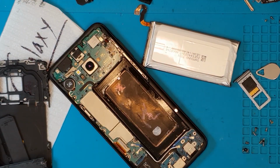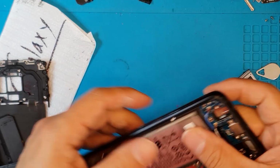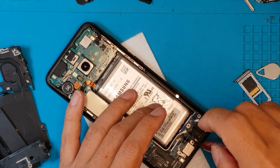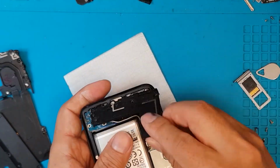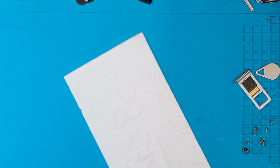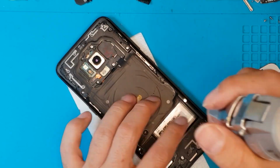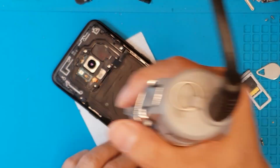So with the battery, the proper procedure of extracting the battery is very important, since the Galaxy S8 has a very strong high-powered battery, and if you don't disconnect this properly or you puncture it, then you might end up with an explosion or a fire. So this is easy to look at when you're just watching it on the video, but if you're trying it yourself, it may be intimidating to most people or to novice DIYers out there. So if you don't want to risk damaging some electronics at the back, which are more costly to replace than the display, then seek professional help.